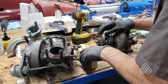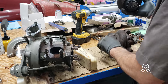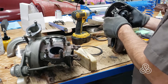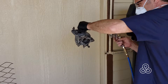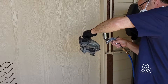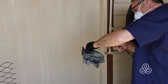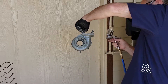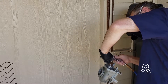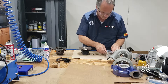One good hit finally breaks that thing loose. Make sure you're pulling straight apart, not at an angle. Moving on — I'm going to do the turbine housing in Cerakote ceramic coating. I found a nice color called titanium gray that looks really good. One benefit of Cerakote is it's so thin that if any sprays into the turbine housing it causes no interference with the blades.